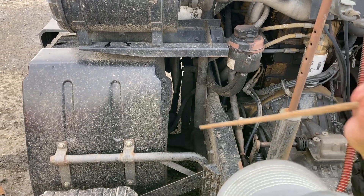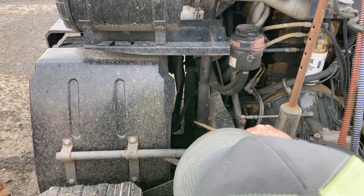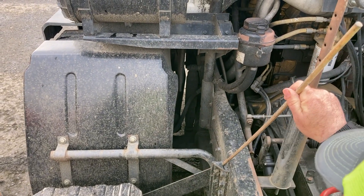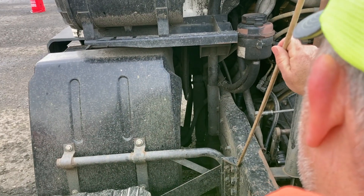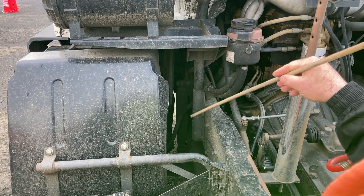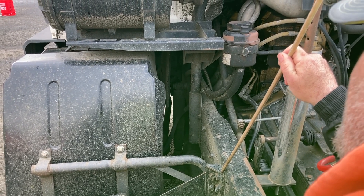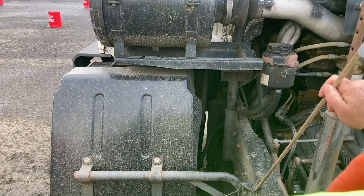From there I want to get my brake system. Air lines and fittings — the air hose supplies air to the brake chamber, and I'll inspect that to make sure everything is secure on both ends, not leaking, and the hose is not cracked, damaged, or kinked. From there I'll go to my brake can and clamps — secure, not missing, not dented or damaged, not leaking. From there, I'm going to go to my push rod and slack adjuster — they're secure, not bent, broken, cracked, or damaged. The push rod and slack adjuster will have less than one inch of pull if I pull it by hand with my brakes released — that's how I'll check my brake adjustment.